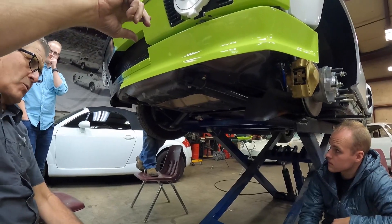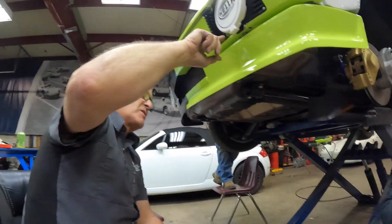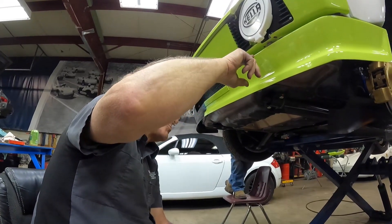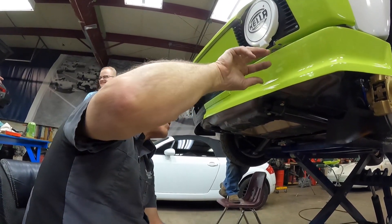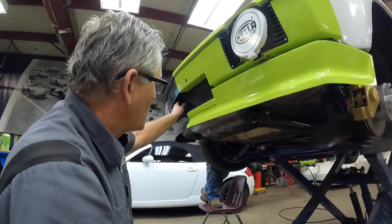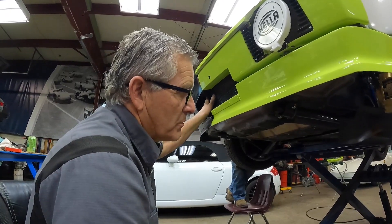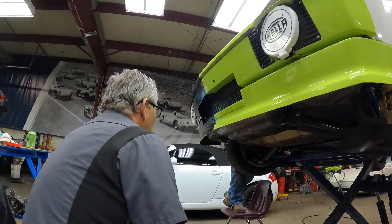The reason I didn't go with the regular ones — where they put the hose up here and run the duct — is because it fills with tire clag. They're always getting clogged up, and that's another problem. Every time we pit we'd have to clear the tire clag out of our front oil cooler.